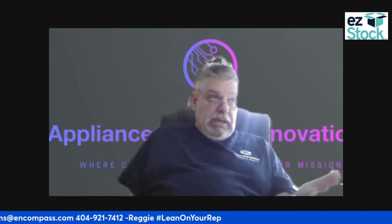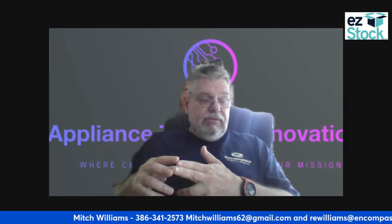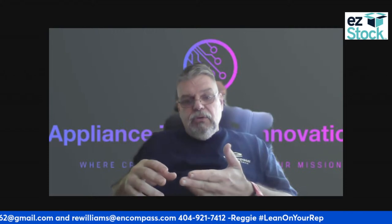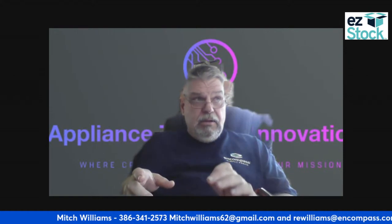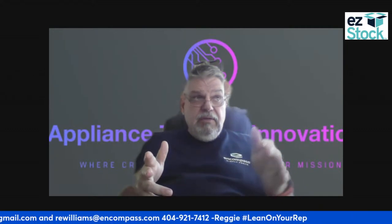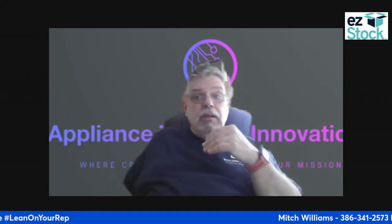You'll then have access to service bulletins. It'll tell you exactly where the product's RJ45 port is located, so you'll know where to plug it in. Some of these are underneath, like on the refrigerator. You can pull the toe plate out and put the plug right there, behind the toe kick. There are some that are on the top. On washing machines, I believe the older ones had a couple on the backside, but today they've moved them towards the front. So you get to know where everything is.